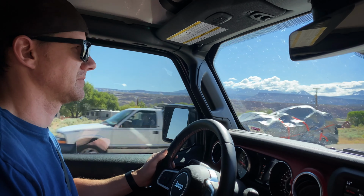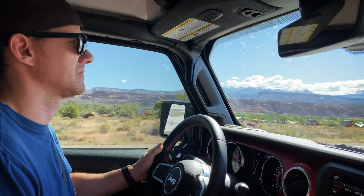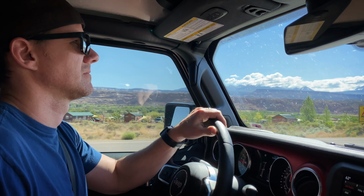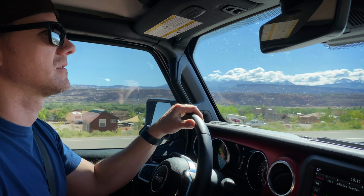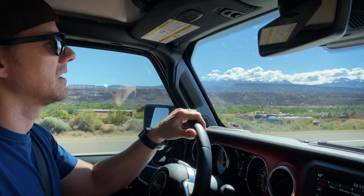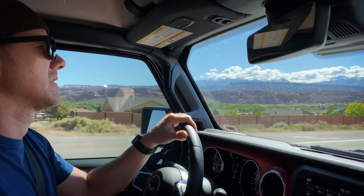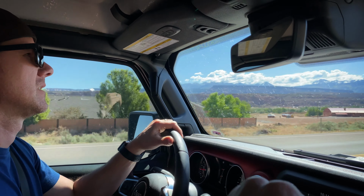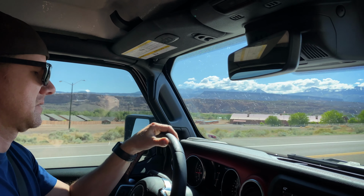Yeah, I mean, the steering wheel looks real close. We could make a slight adjustment, but it's up to you after you drive for a little bit. I don't know if there's any crosswind or anything, or if there's a crown on the road. Those are the things that can make it feel like it's not completely centered. But again, it's a super easy adjustment. It's those two clamps. You just loosen them and then have Michelle sit inside, and you just tell her, or you have her turn it a tiny bit. Either way, it's just minute changes.